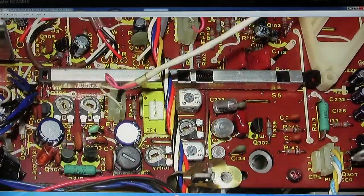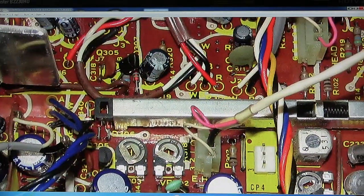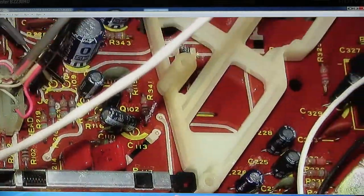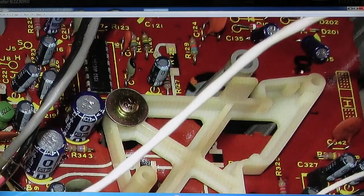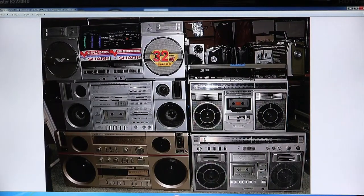That's the nice thing about Panasonics - they use nice wide flat belts. They last practically forever, or at least a very long time before they go bad, and most of the time they don't go to goo like some tape belts do. This here is the recording bar - no one's ever seen one before. It's right there, goes from here to there, and it's actuated by that right there.